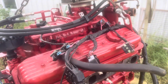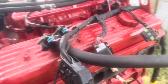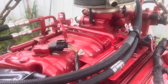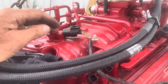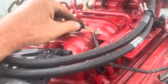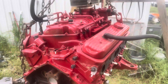The harness is coming off — I'm unwrapping it from the port side around the front, going around to the starboard side with all the injectors disconnected. The last one I'm unplugging is the MAP sensor, which was underneath the distribution center so I had to remove it to get to the MAP sensor. The MAP sensor is one of your primary load inputs on the engine. The MAP sensor, crank position, and coolant are the only things a fuel injection computer needs to run an engine — everything else is auxiliaries. I've got to loosen these bolts to take this whole plate off and it'll go with the harness.